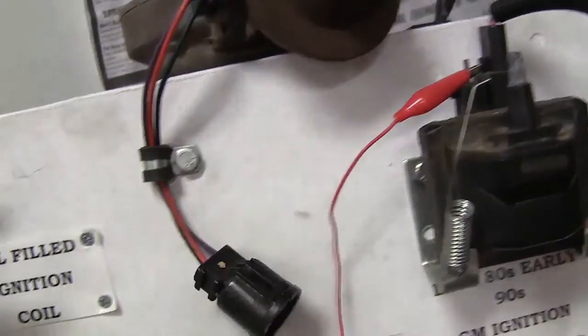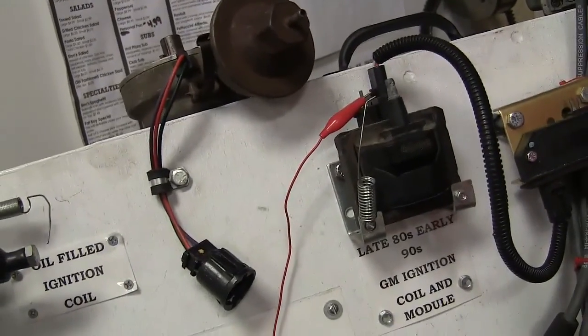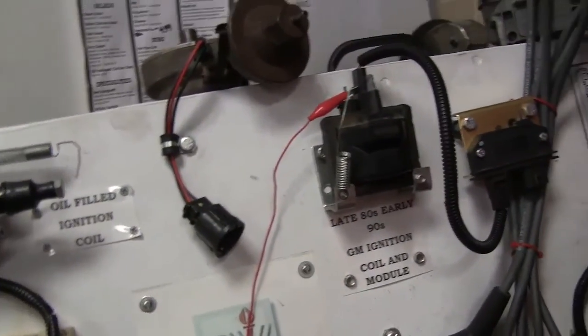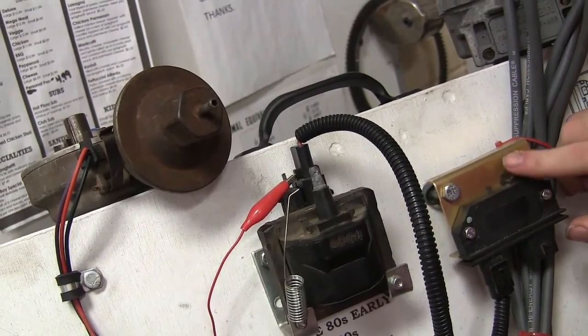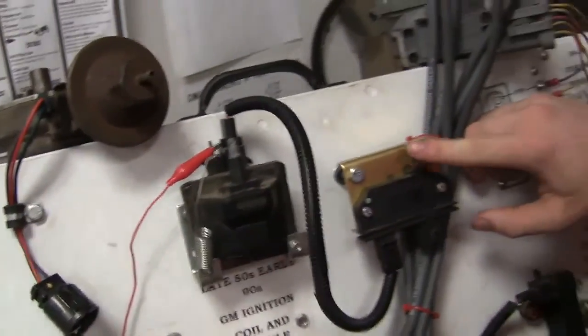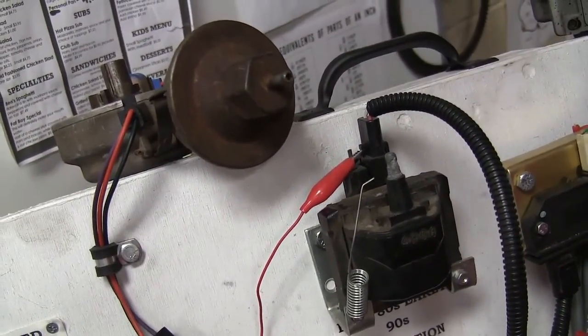Put power to right here. Now do you know what you're going to do to fire that one? Lick your finger, touch this — with your other finger, lick it and tap those. Why is that doing that? Power is traveling through your body. Now grab that distributor right down there and very gently plug it in right there. Hold that distributor in one hand and turn it with the other. When you're turning that distributor, that same kind of pickup coil deal is very similar to this over here and is firing that coil. This is an E-core coil.